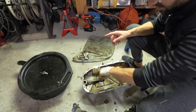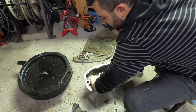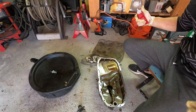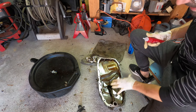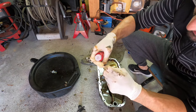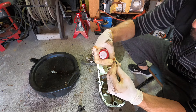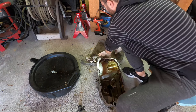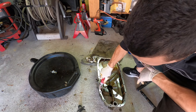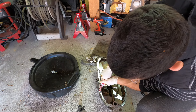Next I'm just going to degrease the edges one more time and then we'll apply the sealer coat. But before that, let's do the oil return line real quick. We have everything cleaned off here and on the car. These are the seals from the return line — they're not cracking as bad as I've seen before, just cracking a little bit. All surfaces have been pretty well cleaned. Now we'll go ahead and apply this Loctite gasket maker, which I will link below if you guys want to do this yourself.